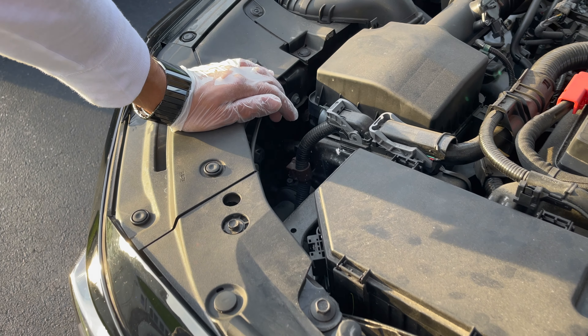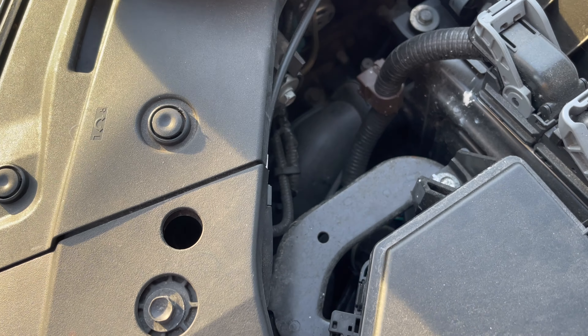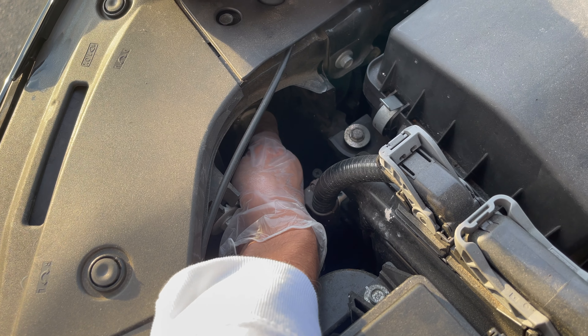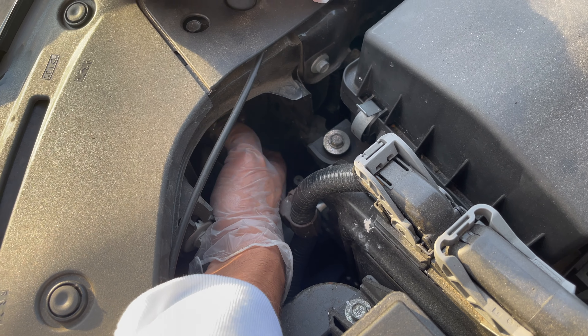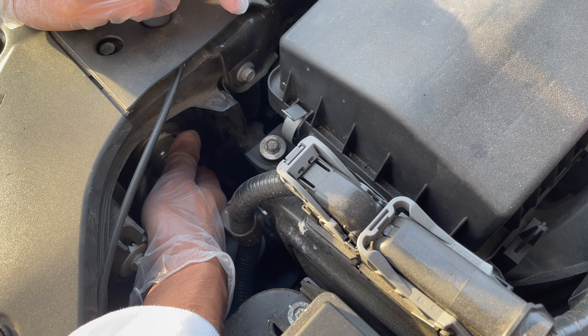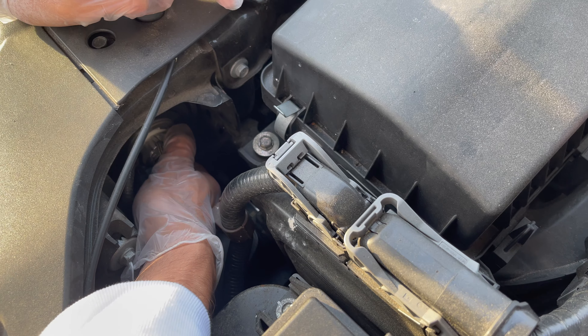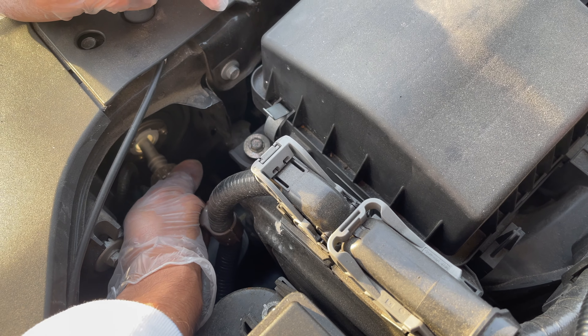Welcome back to my channel Red Line Mods. I got so many questions about how to change the high beams. The driver side is down there, and it's really easy — you have plenty of space. I already have upgraded ones in my 2018-2020 Accord; I'll put the link in the description below. So let me show you guys where it is — right here. You just turn it counterclockwise, towards the left.